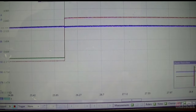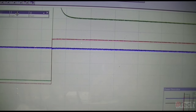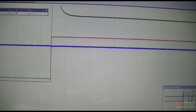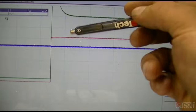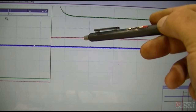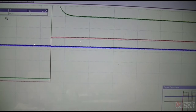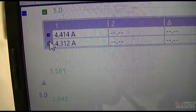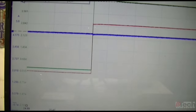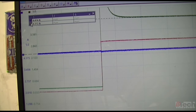If we look at the turn on, if we look at when both were on, we can now also measure the amperage of the driver's side, but also watch what happened when it turned on. It's part of why I had the voltage measurement going, so that we can tell within the blue line when we fed the power to see what happened with the amps with the one that is feeding basically both sides. As far as amperage on the other side, we're pretty much the same. So it's drawing the same amount of amperage, and that's because it's single circuit alone, just the bulb and B plus from the battery. So it makes sense that it's going to draw the same.